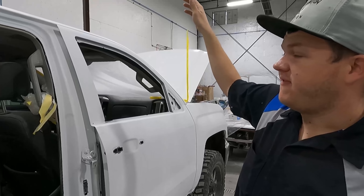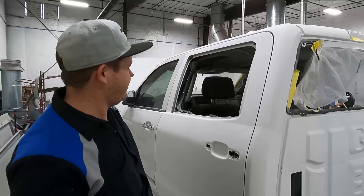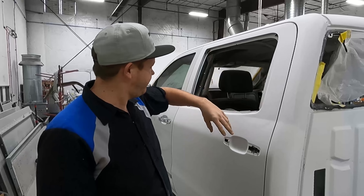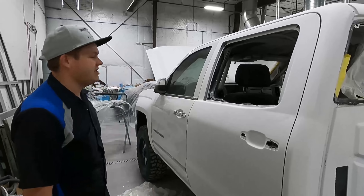It's a factory peeler so we're doing the roof, the back panel, this unibody side with the rocker panel and upper A-pillar. We've got the back door already — primer is feathered out and prepped, back door is all sanded down with 800. We're ready to get this thing blown off and put inside the booth.